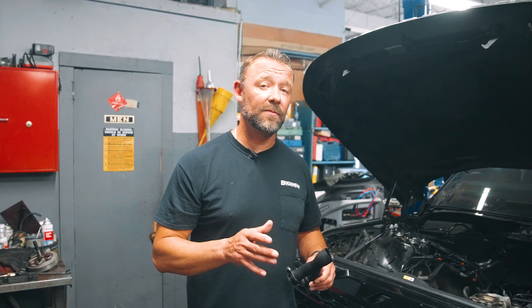These particular model cars are great cars — when they're running and driving, they're absolutely fantastic, plush inside, and people love these vehicles. But knowing about these pieces of plastic underneath the supercharger that crack and break is important. We're starting to see this fail as early as 60,000 miles and as late as 90,000 miles. It's just so hot in the engine compartment, and that's what's causing this to fail. You could drive out of my shop after an oil change and two blocks later this could crack. When this thing has a low coolant light, pull the car over and stop — have it towed to an independent shop or dealership so they can replace this piece and not do any damage to your engine.